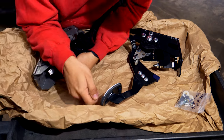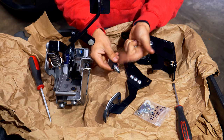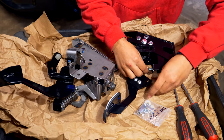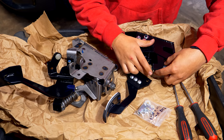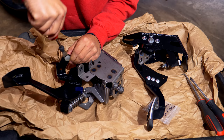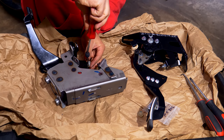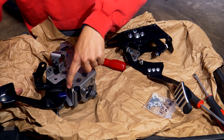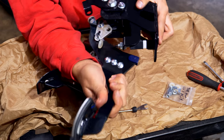Transfer the upper and lower switches to the new clutch pedal assembly. Grab one of the nuts included in the hardware kit to replace the nut on each switch — remove the old nut, thread the new one on, and insert it in the exact same orientation as the factory pedal. The factory nut we removed will then sandwich the sensor to the clutch pedal assembly. In addition to the two switches, there are two opaque rubber bumpers that need to be transferred from the old pedal to the new one — use a fastener removal tool to pry them out and push them onto the new assembly. The last part is the blue pedal stopper — when the pedal reaches the end of its stroke, the bumper hits the backside of the pedal assembly to prevent metal-on-metal contact. Install it in the same orientation as the old one.